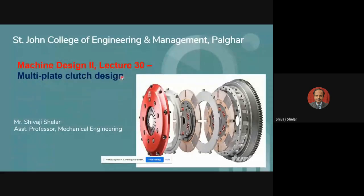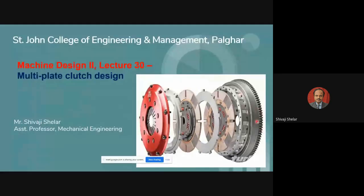I have one diagram for a better explanation of the multi-plate clutch system. You can see this is a flywheel having engagement with the outside. On this flywheel, a plate will be mounted. This is a friction plate, this is a pressure plate. So alternate friction and pressure plates are mounted. Then there is the cover. This assembly can be completed in a sequential manner.